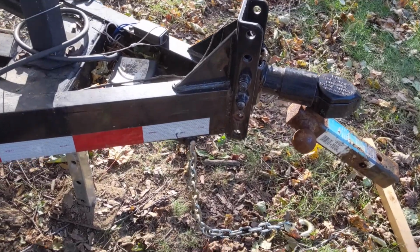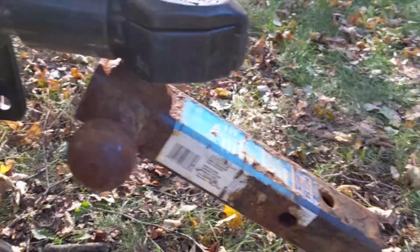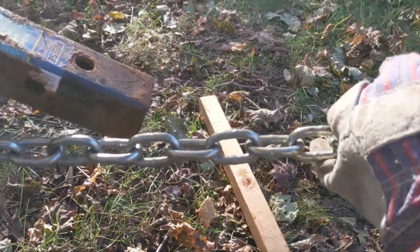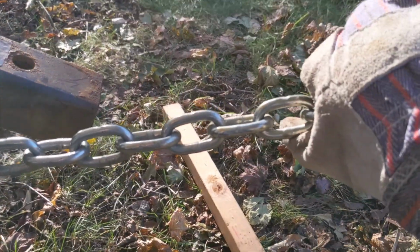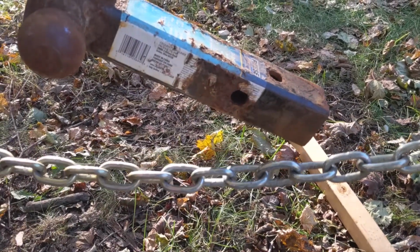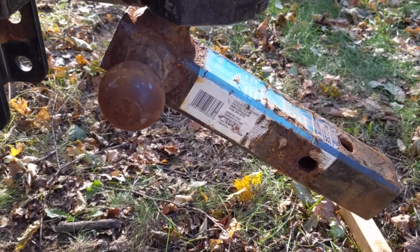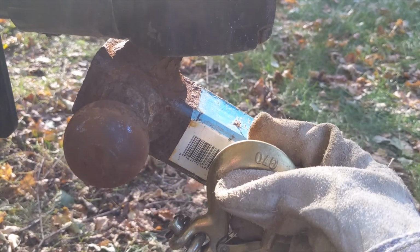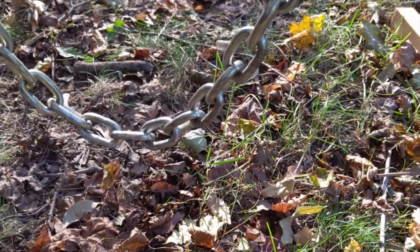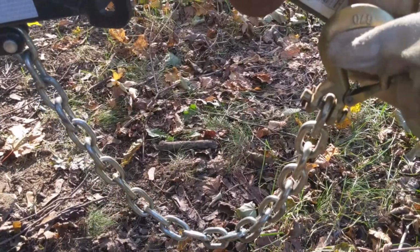Okay, tip number 2. Now, I told you that this is a 24-inch chain. It can obviously go a pretty good distance out in front of both the tongue and the hitch, right, and beyond. What happens if this is too long? What happens if you're doing, let's say, a small landscape trailer type of connection, where you can actually put the hitch right on a ball that's connected right to your bumper, and the chain would connect essentially right here? That's an awful lot of sag, right? That's down pretty close to the ground. How do you combat that?